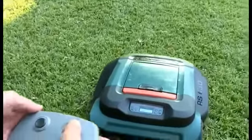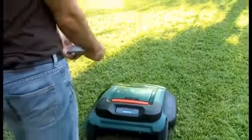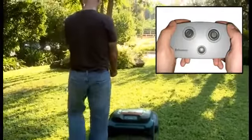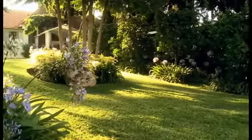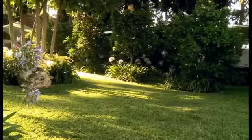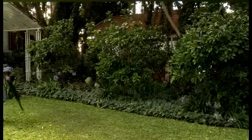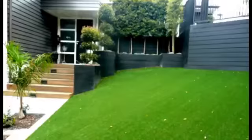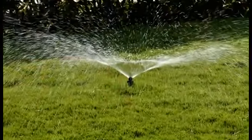You may use the remote control to drive RoboMow to and from the separated zone. A remote control is available as an accessory. Your first step is to determine the best location for the base station on your lawn — place it in the largest zone. We recommend finding a shady spot in the backyard where it's not visible to the street. Do not place it on a slope or too close to a corner or sprinkler.